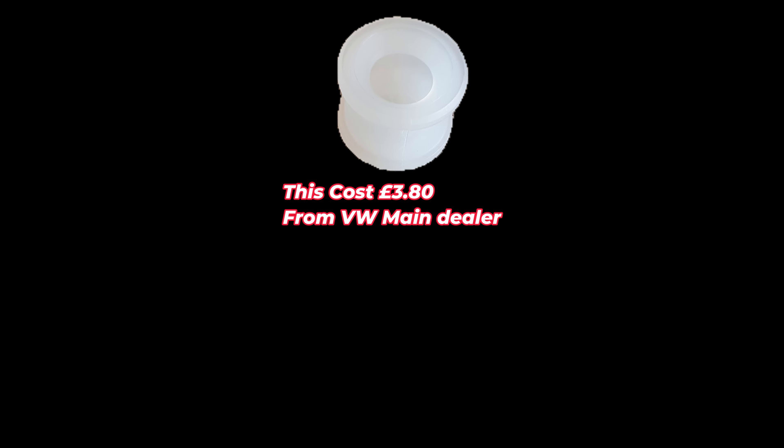So you want to wedge that in behind. And what that does then is when you push the ball into the actual grommet in behind, it doesn't push through the actual nylon housing — ball joint housing. It doesn't shove it through the other side. So just put that up against the engine block, then you've got something to wedge against. So it's not going to push the grommet out the other side, which is not good.